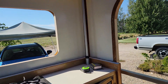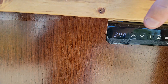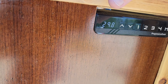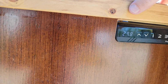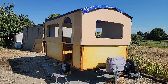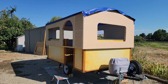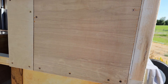That's the lift — let's put it down now. You can access the controls from inside or outside. I'll just hit one and watch it come down. It only goes up to 29.8 and only down to 0.2, so there's a 0.4-inch shortage from a full 30 inches — that's what made my side hatch door a little overly tight, but it's no big deal. It takes about 75 seconds to go all the way up and down, slow and steady, running smoothly on the four corner actuators.